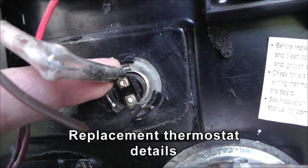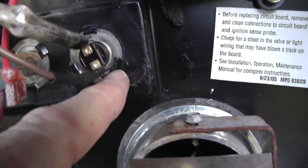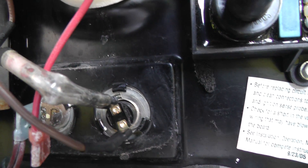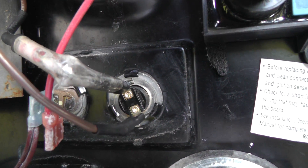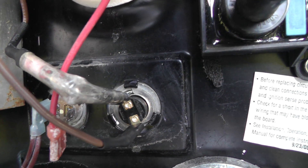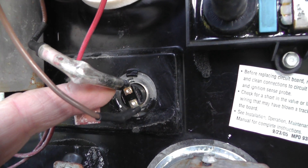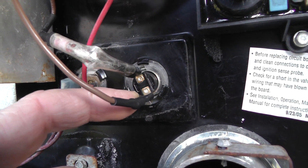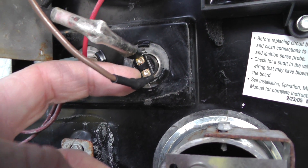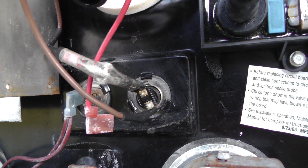When replacing this, you'll see there's a plastic disc here which you basically rotate to the three lugs and pop through a little slot to gradually pop it out. There's a spring-loaded mechanism underneath that which you'll want to keep from the old temperature switch and use on your new one. That spring just rests behind this plastic disc and pushes the front face of the temperature switch against the tank. The connectors here are automotive spade connectors — for the slightly smaller size, not the standard ones which are about 6mm wide — so I just had to solder on new connectors to connect up to the new temperature switch, but other than that was pretty much all that was needed.